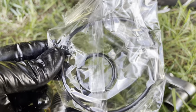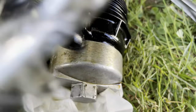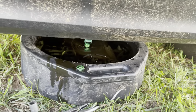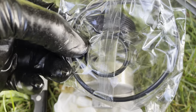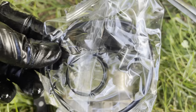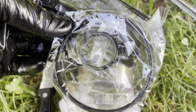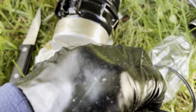The new gasket came with the filter. Make sure you get it in the right groove — there are several threads but there's a specific groove it needs to sit in. For the two o-rings: I didn't replace the smaller inner one because I didn't use that center drain feature. If you do use it to drain the housing first, you'd need to replace that inner o-ring too — but I didn't, so I'll skip it and just replace the big outer one.